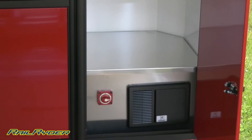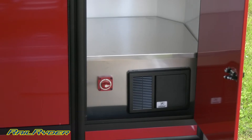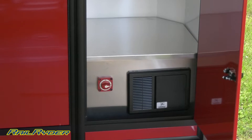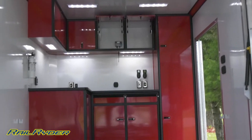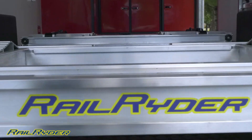We have a master kill switch down here at the bottom that kills everything 12-volt in the trailer. The black box is a 60-amp converter that, when your generator is running or you're plugged into shore power, maintains the 12-volt battery in the trailer. This trailer has all 12-volt LED lights running from that deep cycle battery, which you need to maintain based on how much you use your lights per event. If you run these lights for six or seven hours, you do need to maintain the battery by some method.